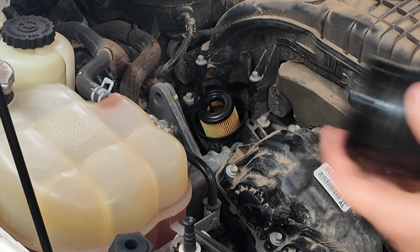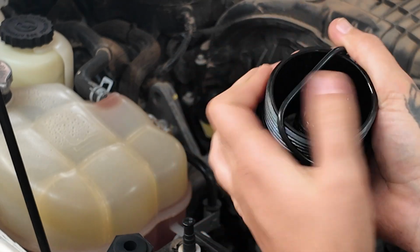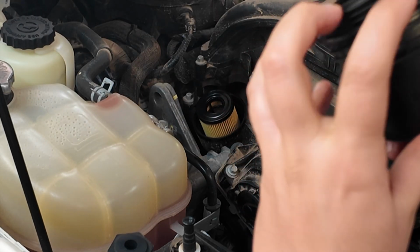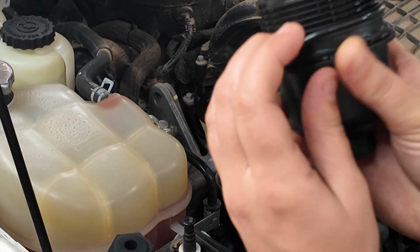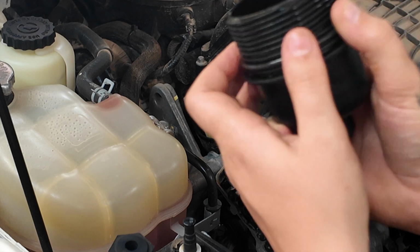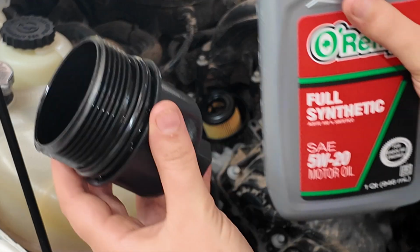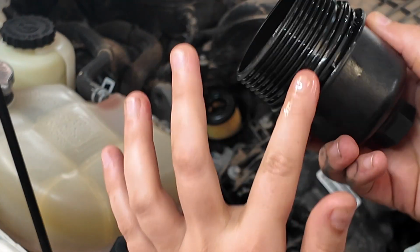And then when we go to put the new O-ring on the canister, I start it first by putting it on the canister and then oiling it. That way it's easier to handle and you're not trying to slip and slide around with this thing. And make sure it seats at the bottom here. You don't want it in your threads. That way it has a good sealing surface. And then again, you can take some of your new oil and lubricate around it. Run it around the O-ring.